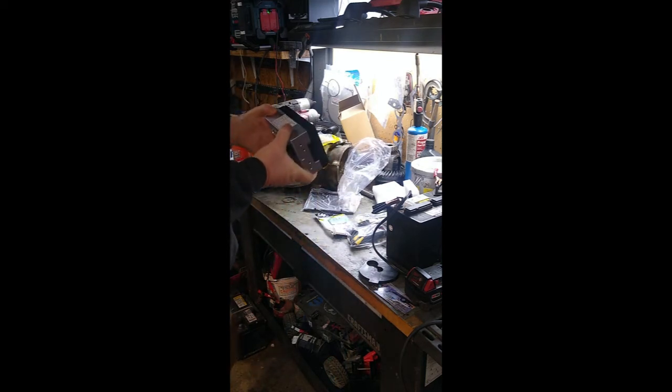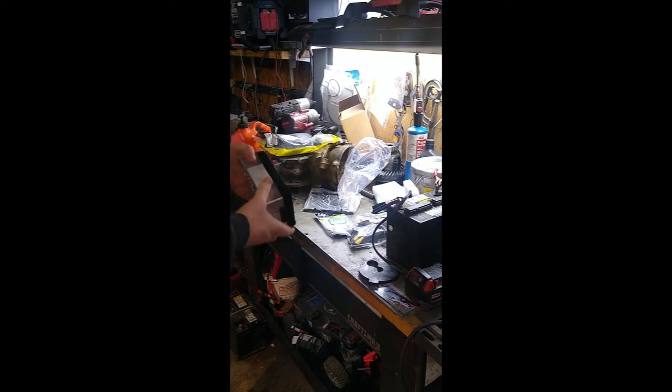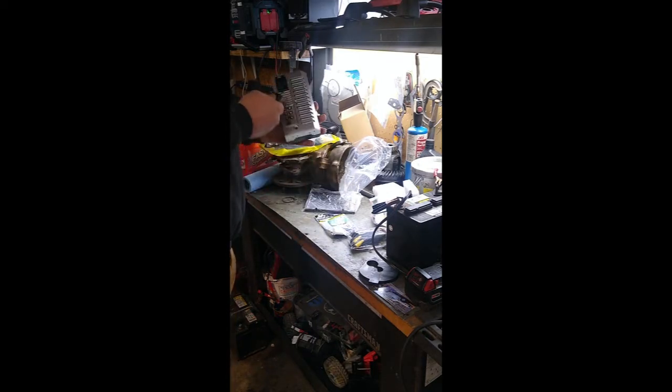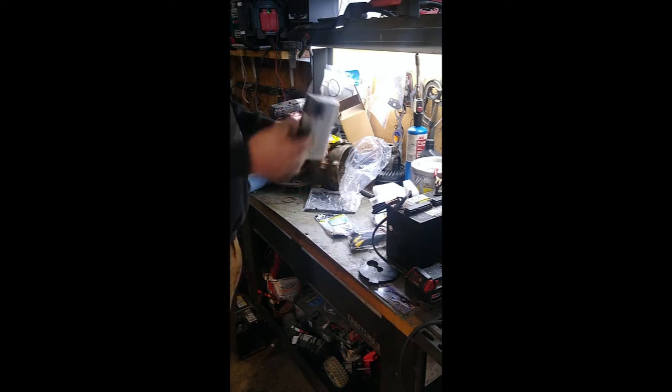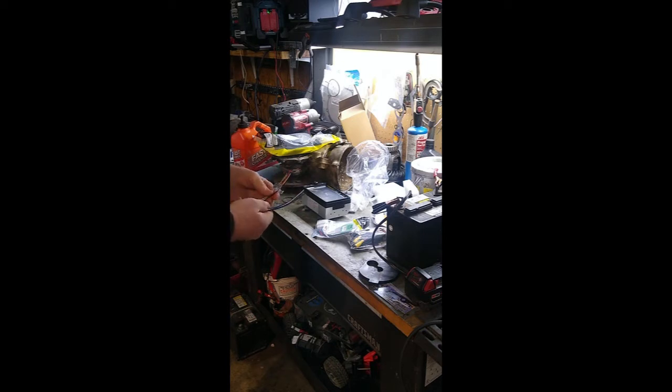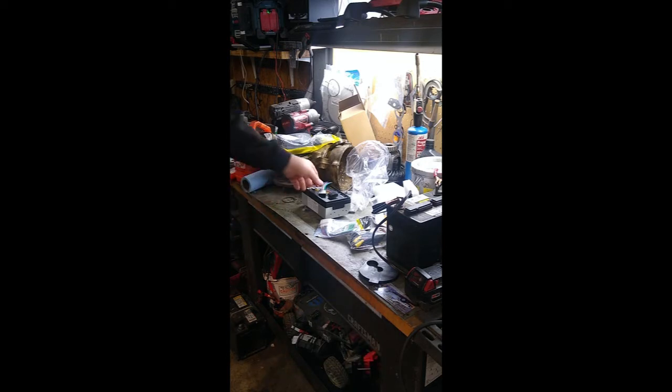Here's the wiring diagram. It comes with the wires to plug into the radio. We're going to be connecting these wires from the harness to the radio's wires — hopefully we'll have power, sound, and all that. It looks like one connector has accessory, ground, power, and memory, and the other has all the speaker wires. They may match up with the Honda colors since it's pretty universal, but I always check. Get yourself a wiring diagram for your car and double-check that the right rear speaker wire color matches the radio harness color, and so on.